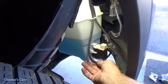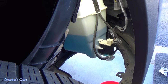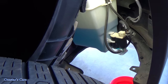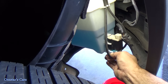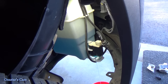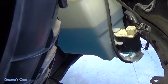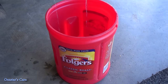Then remove your two hoses. If you have washer fluid in the tank, this is the time to have a little catch can — there's probably about a half gallon of fluid you'll want to save and reuse. Just unplug that hose; it'll start dripping. There's one on the back side too. Let that drain out for a minute.